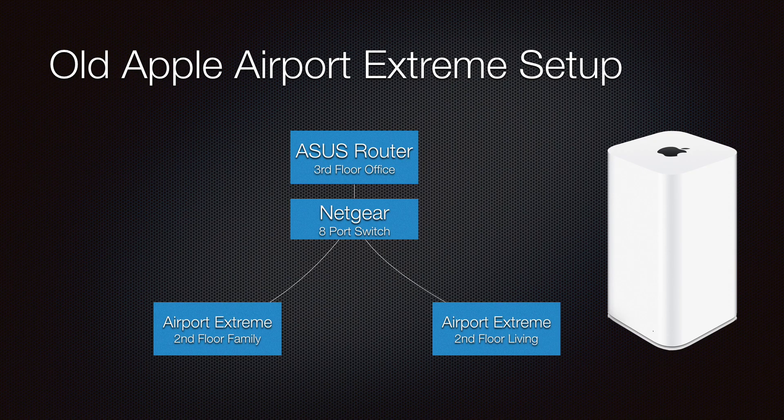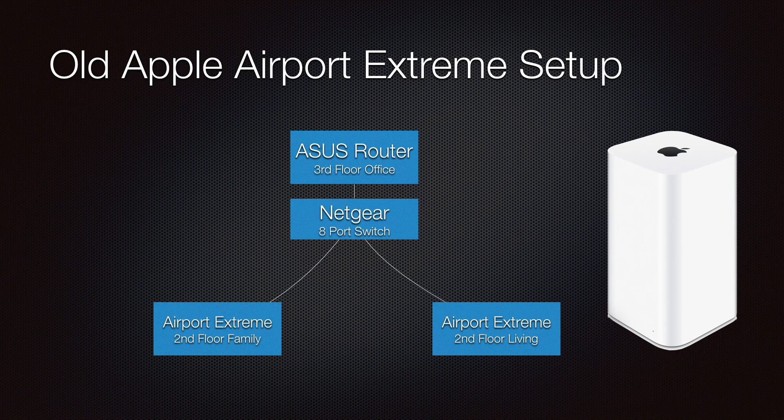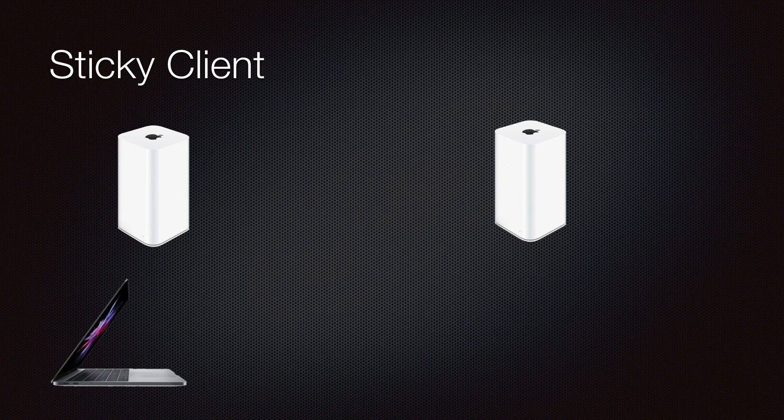Let's say with my MacBook — I went from the family room to the master bedroom and the connection would stall. That is what the network admins call sticky clients. I put a link in the description. I set up the airports as a roaming network with an Asus router in the office and the airports acting as a wireless bridge in other areas of the house, all sharing the same SSID. The problem is that whatever the laptop first connected to, it will stick to that access point even though there is a closer one with a stronger signal.